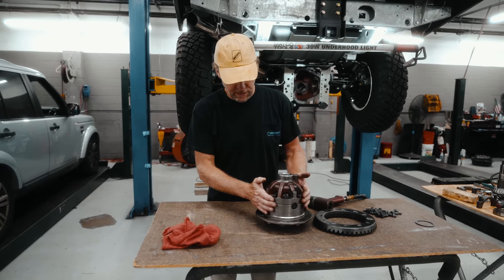So right now I've gone one revolution around. You can also see that on the smaller gauge over here. So one revolution around is 0.1 of an inch. So all the way across here, and we've gone one revolution plus 5/1000ths. So we'll make a note of that. We have the carrier out of the casing again, and we've measured the distance that this traveled left and right, which was 0.1 of an inch.